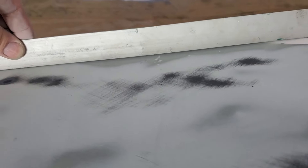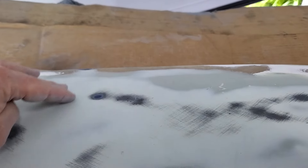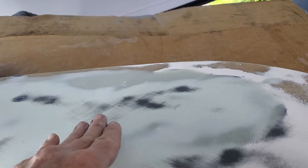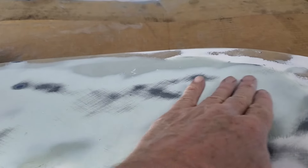The way you do this is actually quite easy — you see where it's hitting on one side and the other. I'm going to run some tape up on either side of where it's low, and then we can just fill from here up. That'll flatten the door out and then we block it up.